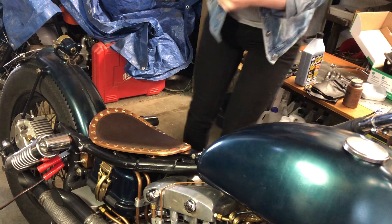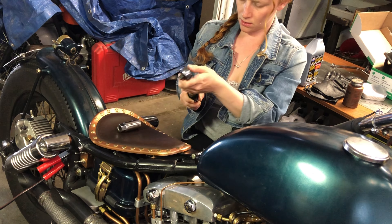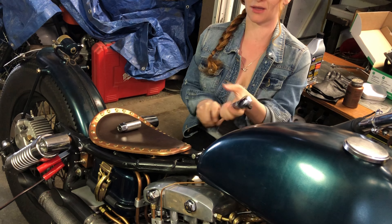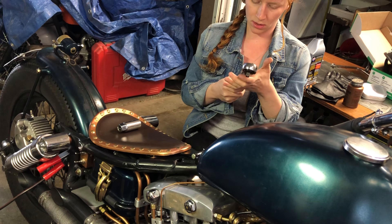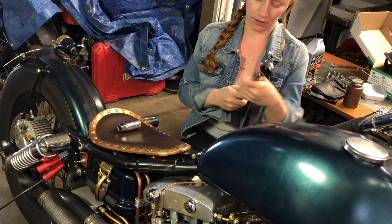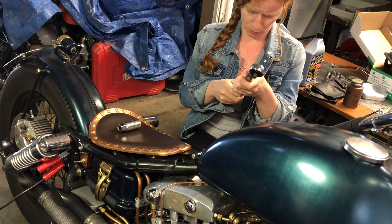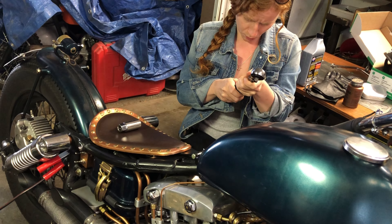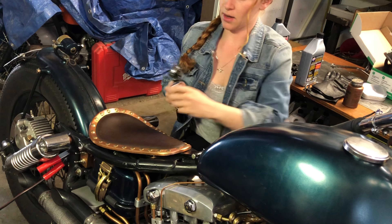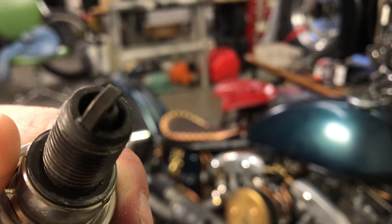I'm going to use a torque wrench — I do 15 foot-pounds, or 180 inch-pounds. I see specs out there anywhere from 12 foot-pounds to 18, so I figure I'll just go somewhere in the middle. I believe 15 foot-pounds is about 180 inch-pounds, so I'll go 175 inch-pounds and call it good at that. So that is my front plug after just a short ride.